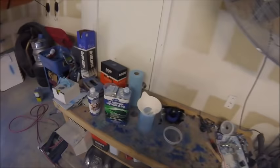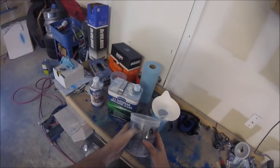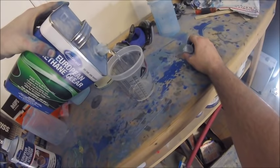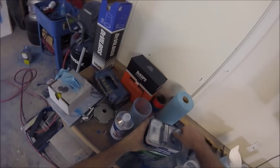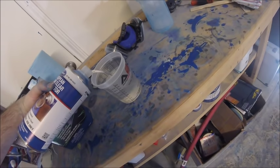And so, all right, let's make some clear coat. This is also a 2-to-1 ratio, so we're going to mix it the same way, where the color goes to 6 and the activator would go to 9. Since there's an activator in here, which I think all clear coats have, you can't save it. So let's mix it. And again, you'll strain the same way, but you will not tack between coats. Not on clear coat.